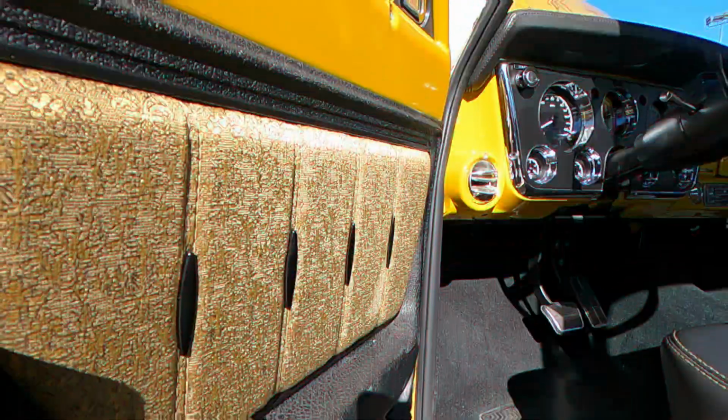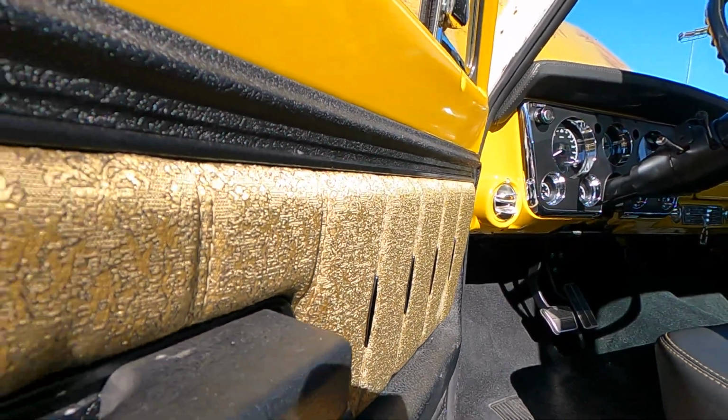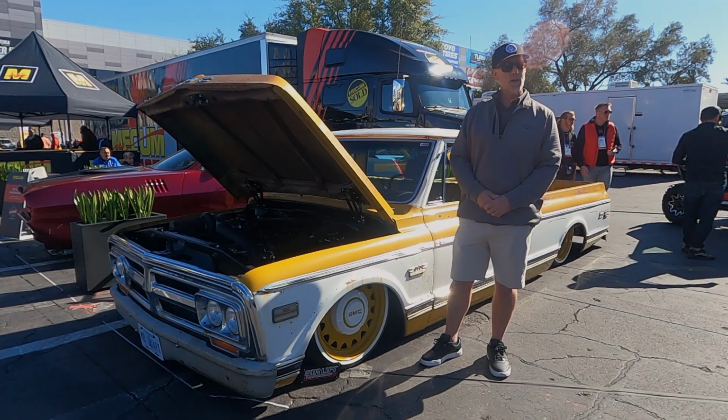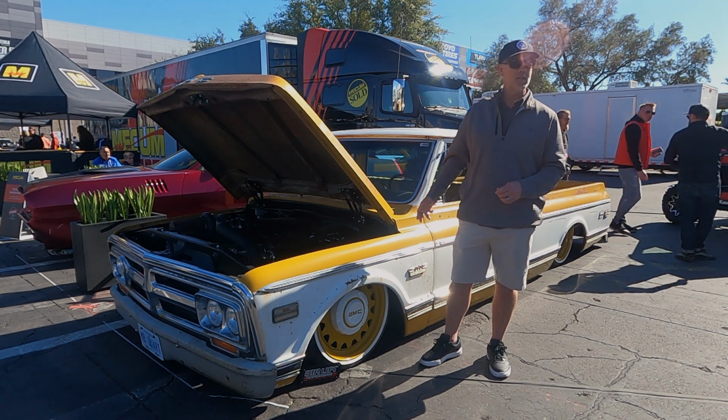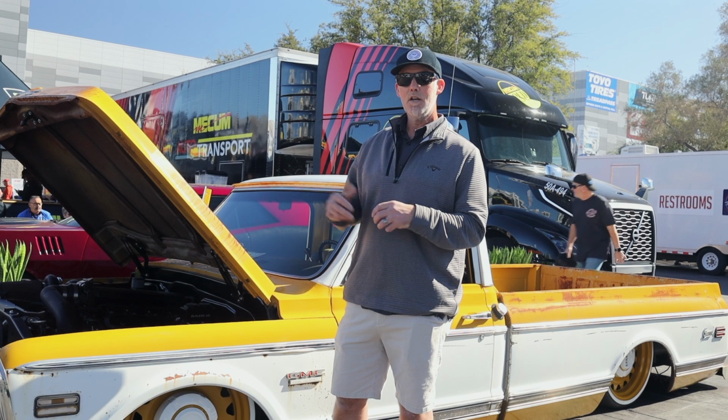On the interior, there's some pictures that are available online, but the kick panels, I wanted something that wouldn't interfere with my feet. And the MB Quart drivers work really, really well off axis. So just to illustrate that, I mounted those facing straight across, and the sound stage in this is real high, real far forward. For subs, we did an 8-inch sub in the front in a sealed enclosure. I built a box inside the fender that holds those drivers. Tweeters are in the A-pillar.